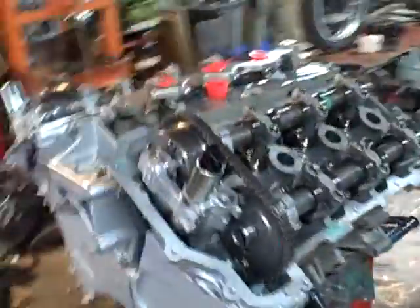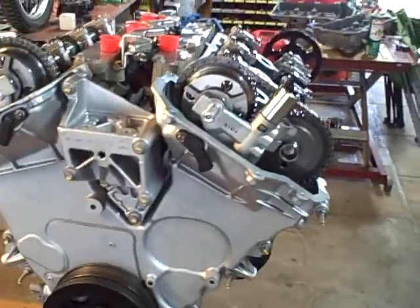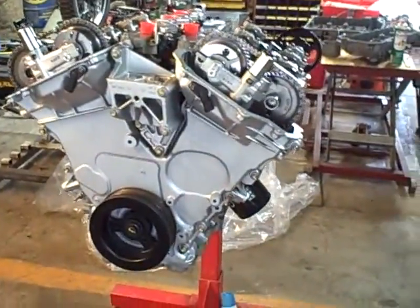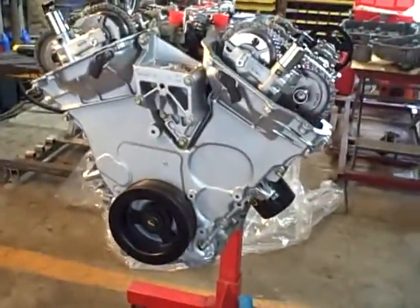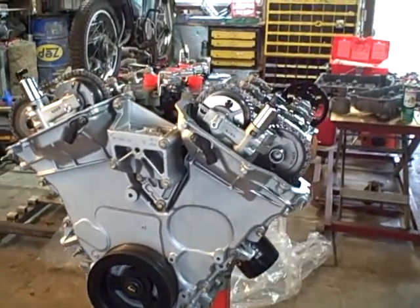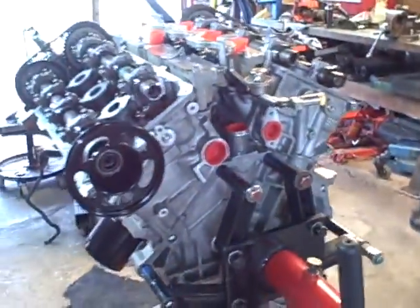That should have demonstrated the noise. I'm not going to say that's necessarily the problem — it might be because it's a little dry. The oil pump is underneath this front cover and I can't take that cover off because it's a rebuilt motor, so I'm going to have to mount the transaxle because the starter mounts to the transaxle with the flywheel.